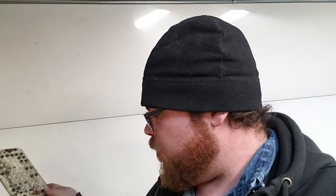But I have some really old jets laying around here. This is just one of the boards. I have another board that's got a ton of like 60s size jets on there. So I'm gonna take some of those. I'm going to figure out the hole sizes of the jets that are in there now and just make a good educated guess upon a little bit of research to drill them out and get the sizes I am looking for.